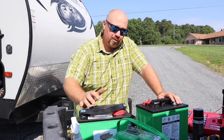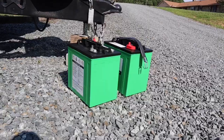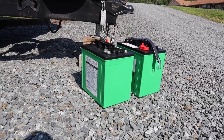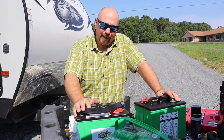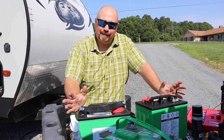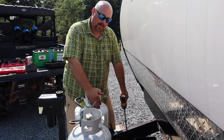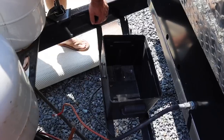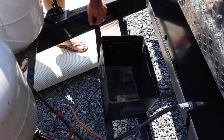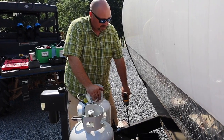One of the reasons we're making this change: we're going from one single 12-volt 100 amp-hour battery to two 6-volt 225 amp-hour batteries running in series, so we're more than doubling the power and how long our batteries will last. Going from one battery to two, we've got to change our battery box. This is what came with the camper — it's just screwed down to the battery tray. Hopefully the new one will fit.